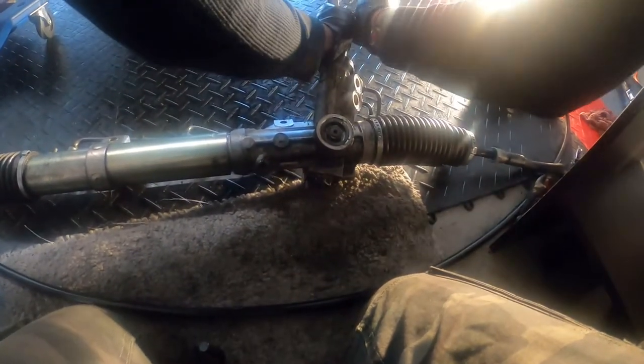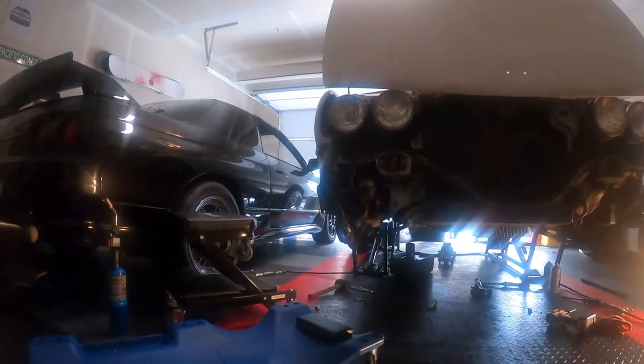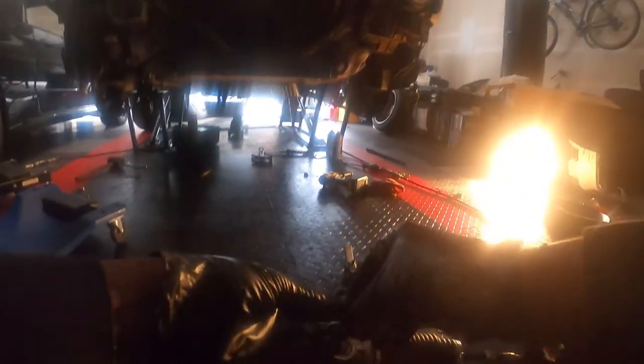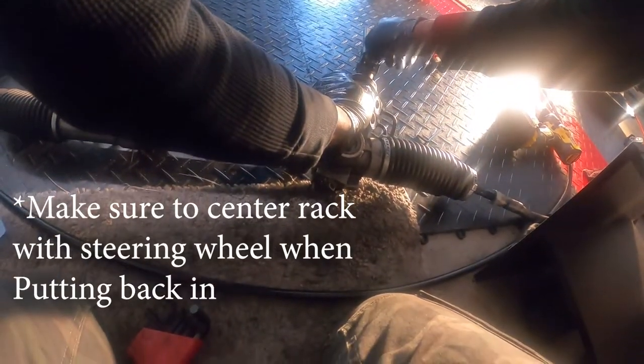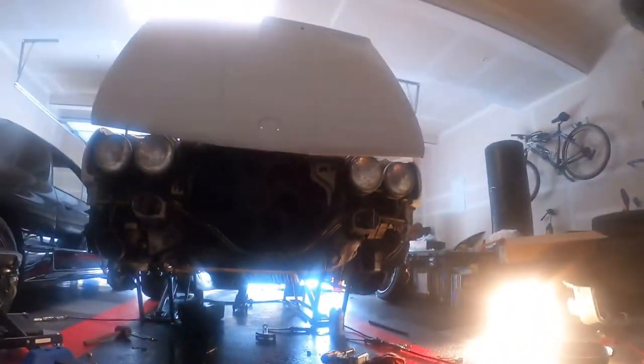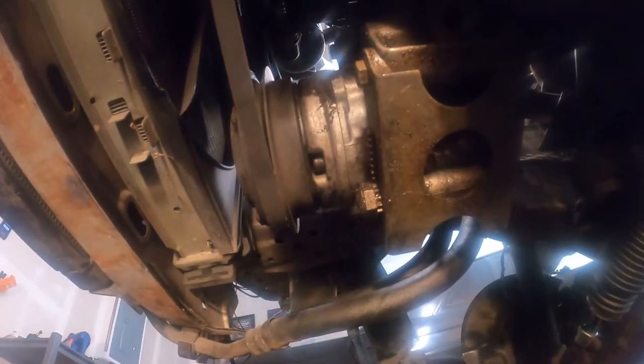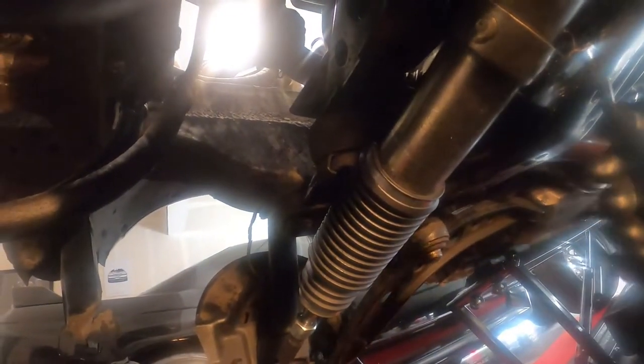Once your indents are drilled, go ahead and use the screws that came in the kit and tighten those with an allen wrench. I opted to do all the tightening on the ground and then re-entered the steering rack and steering knuckle back into the car as one piece. Once it was in, I tightened the top part of the steering knuckle that connects it to the steering shaft. With the rack back in the car, I found it easiest to unbend the tabs with a thick allen wrench — and that pretty much finished up the job.